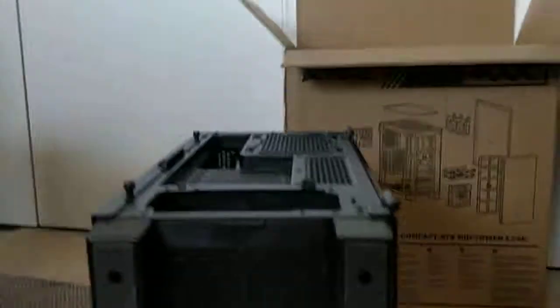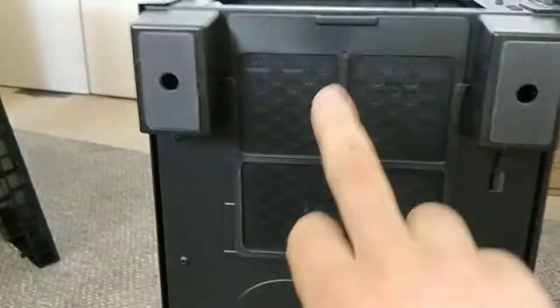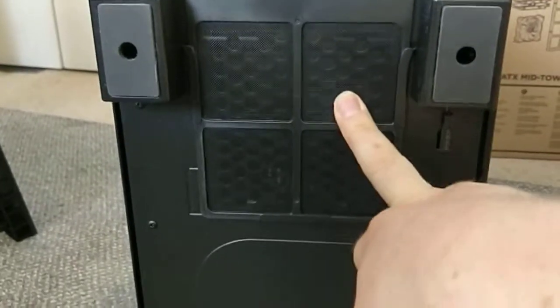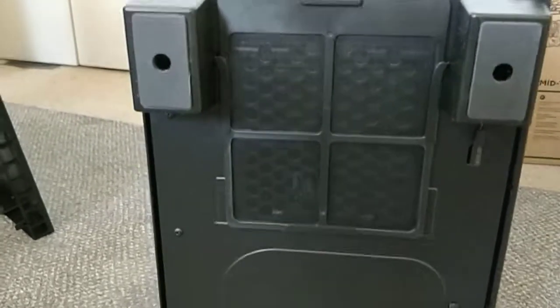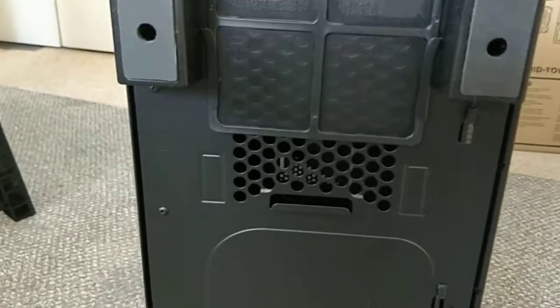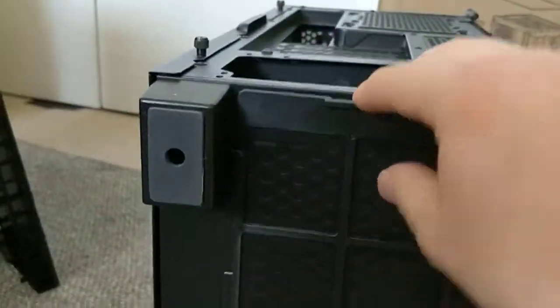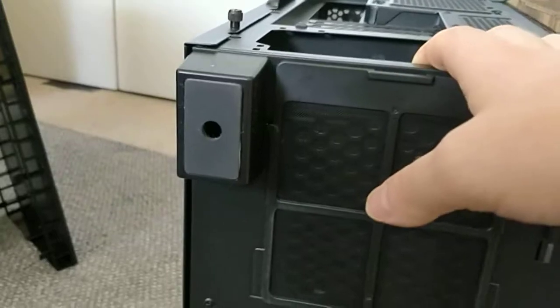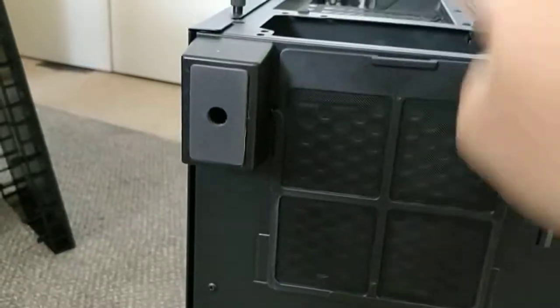There is also a fourth problem. If you've got a smaller PSU this doesn't concern you, but I've got an RM1000, a slightly older PSU. Its fan, even though it would kind of fit in here, would not totally fit, and it might actually cause heat build-up in the PSU which could cause it to overload. The other minor thing is that the air filter is really cheap. I have no idea why they didn't use the same air filter as on the other cases. This is a £100 case - it's not cheap - so I don't understand why.